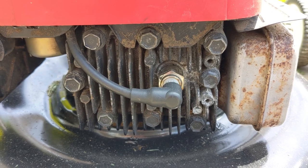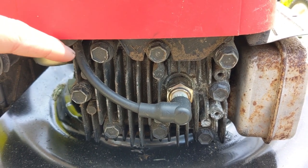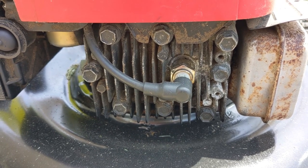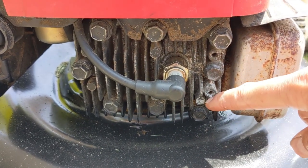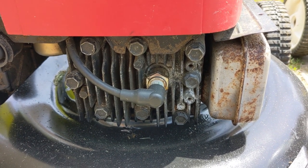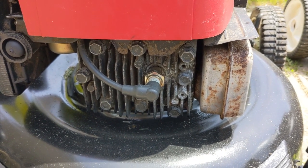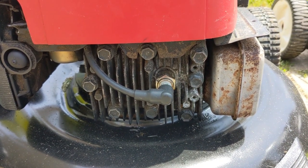Now it might be hard to pick up on the camera here, but here's a great sign that we have a loose head bolt. What you're going to notice is that all of these head bolts here are slightly whitened, and we look into the bottom right corner one there and it's a little darker. What happens is as the head bolt starts to loosen off, oil starts coming down the threads through that bolt hole and it will just start to coat the head of the bolt. Nine times out of ten, the head bolts that are loose on these L-head Briggs are the three down here right by the exhaust port — those are normally the ones that loosen off, because the engine heats up and cools down as you start it and shut it off. That expansion and contraction is what helps that bolt loosen off there.